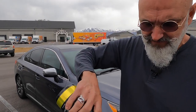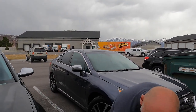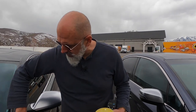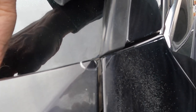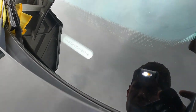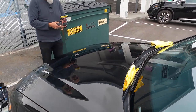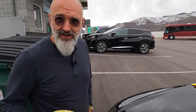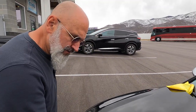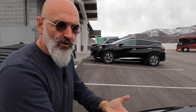There's a new detailer out there who may not even know what they're looking for — how do they tell if there's PPF on the paint? The customer is probably going to tell you because they paid a lot of money for it. Secondly, you can look at things like edges and corners. Here the PPF installer rounded the corner, so you have the paint underneath and the PPF on top — and it's already coming off. You can feel it underneath as well. Check the corners, check under the hood, just look for the telltale signs. Every PPF job starts off good; it's how they seal the edges that makes it more or less apparent over time.